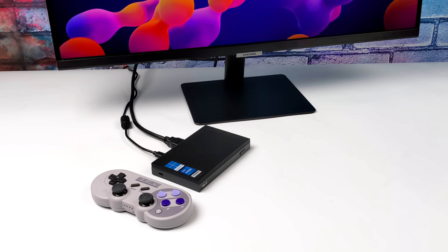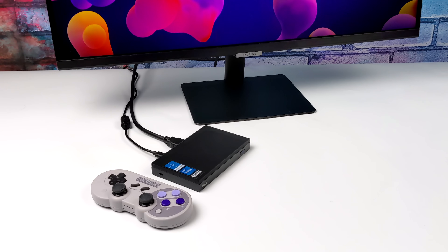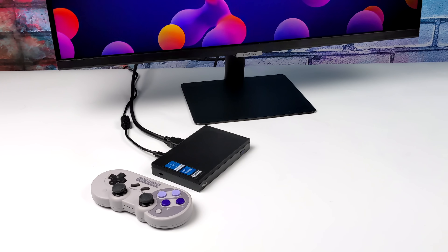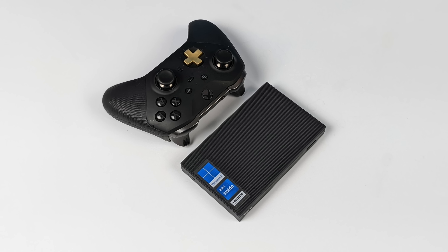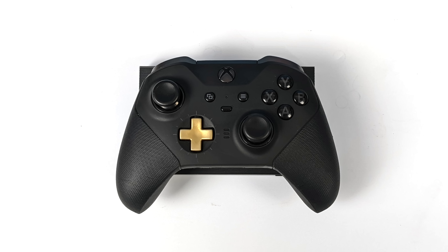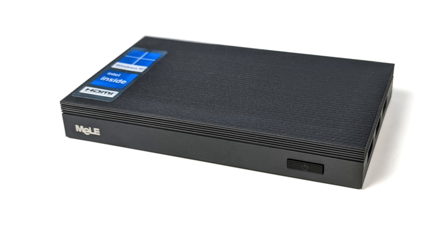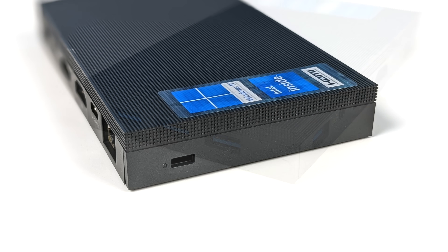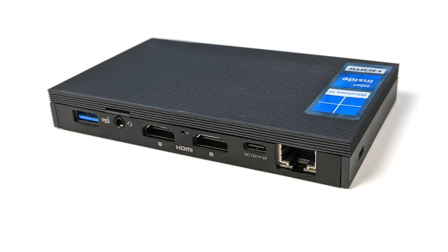Overall it's a pretty neat little mini PC with a lot going for it — the form factor, power consumption, and performance aren't bad even with single channel RAM. It would have been nice to have dual channel; they could have soldered two 4-gig chips instead of one 8-gig chip, which would have helped the iGPU. But if you're in the market for a super small form factor, low power consumption Windows 11 PC for web browsing, email, and document editing, I could recommend something like this. Just don't pick it up specifically for gaming — it was never meant for gaming — but as you saw it can handle some older titles and pretty good emulation up to GameCube. Really appreciate you watching. If you're interested, I'll leave links in the description, and if there's anything else you want to see running on it, let me know in the comments below.